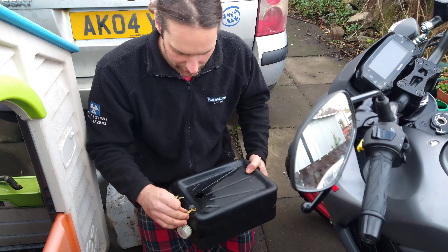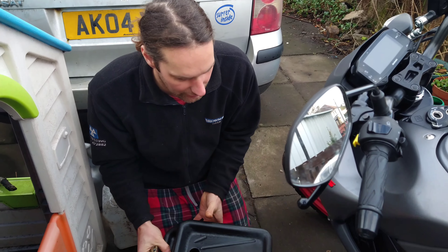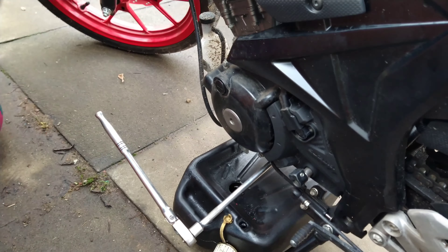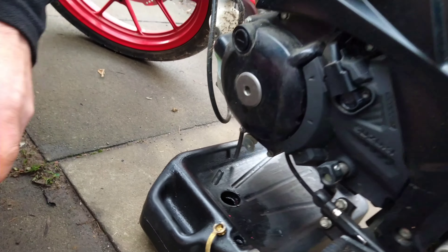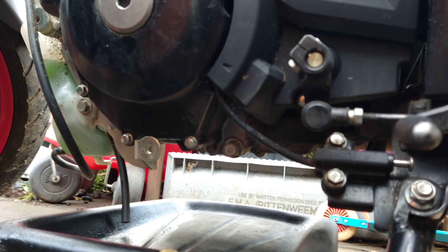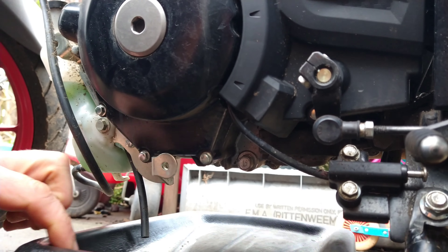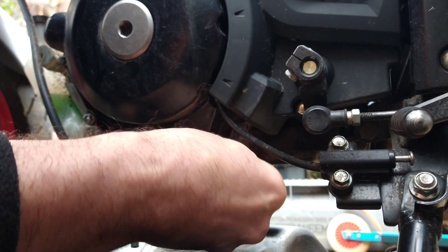Here's the oil drainer - because it's low enough to go under it, it's also going to allow me to take it away and get rid of the oil easily. You need the engine warm and then you switch it off obviously. Right under here - you see there - that's where we're going to take it. It shows you in the manual even if you didn't know. I don't want the sump plug to fall into that hole - that would be a bad day - so we take this off.